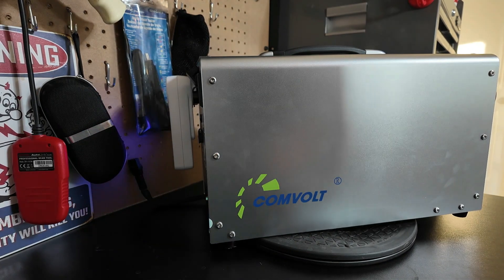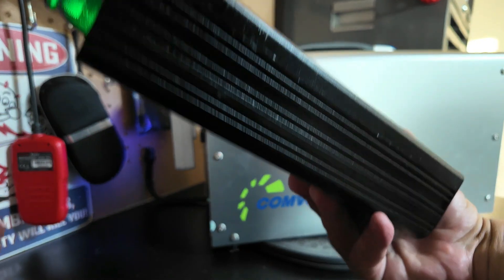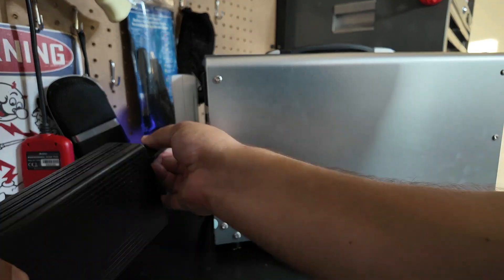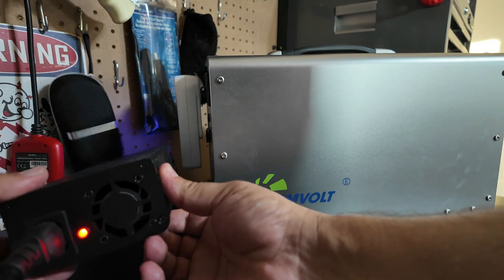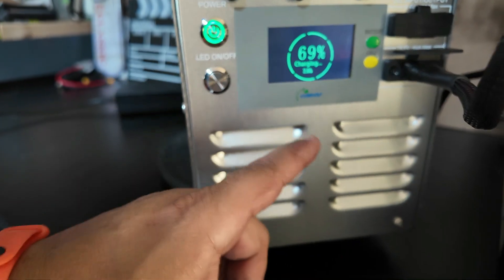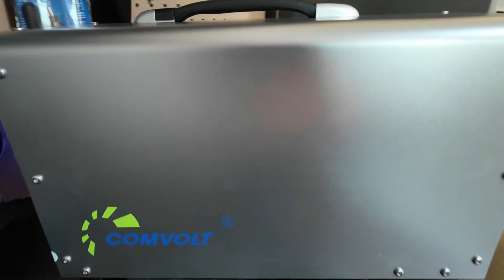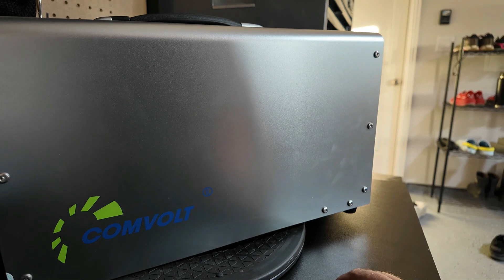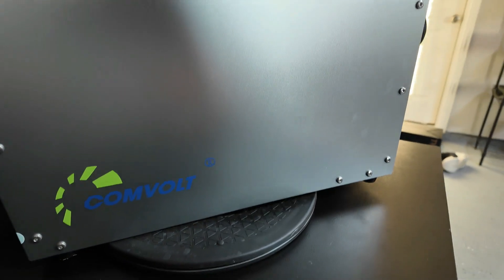The unit can be used while you're charging it. This is the charger — there's a green light, and once you plug it in, the light turns red and it starts charging. It comes with two of these chargers. With just one charger connected, it would be 2.3 hours to reach 100%. I personally like to charge with only one charger — from years of having electric vehicles and working with power stations, I find it's better to slow charge whenever possible.